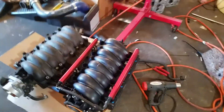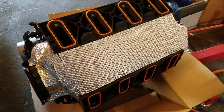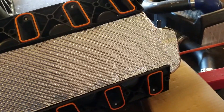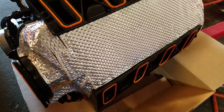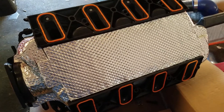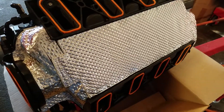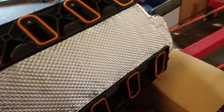Another thing I did that was a little different — I've had this Heat Shield Products heat shield for my LS6 intake manifold that I never put on, so I decided to put it on here. It's a great upgrade, definitely dyno proven. You can go online and check out Super Chevy or Hot Rod magazine — it performs very well. It's only 50 bucks, so definitely worth the time while you have everything out. It only took me about 30 minutes to install.